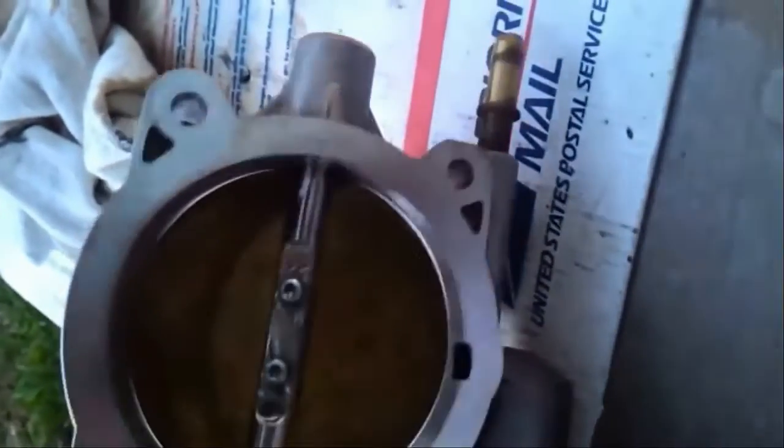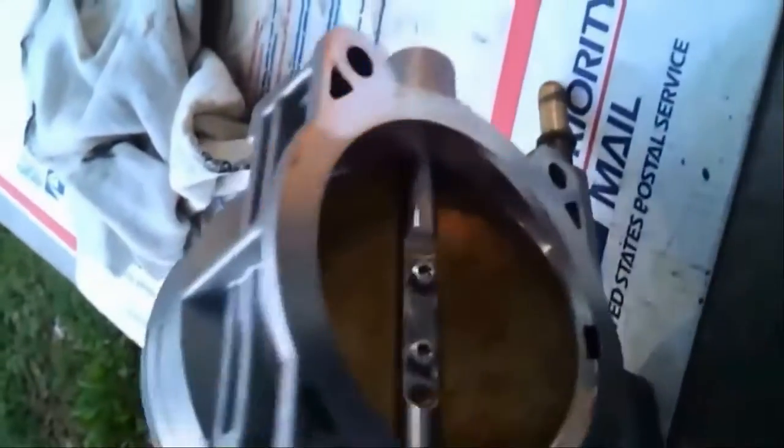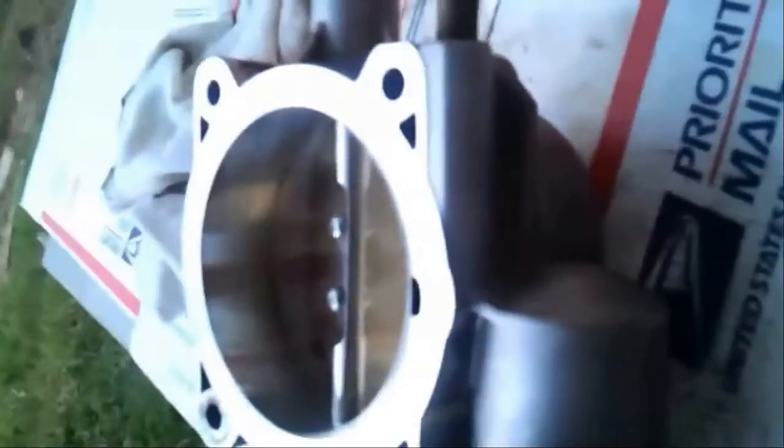It's gonna be about 40 minutes, a couple of rags, half a can maybe. But I don't recommend this, not necessarily this can or brand. It did work, but I didn't notice that it said quick dry. Obviously it really works, but it dries too damn fast. So I guess that's the good thing about the carb cleaner: it doesn't dry that fast and it's stronger. But again, it can melt the rubber parts and electrical connections and all kinds of stuff. So, put everything together and see if this starts.